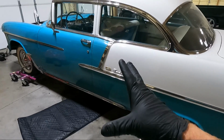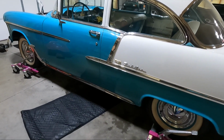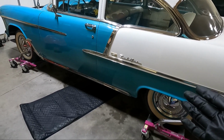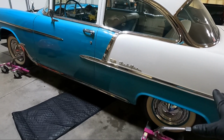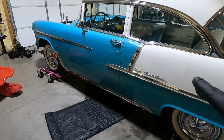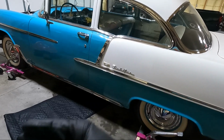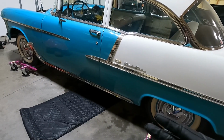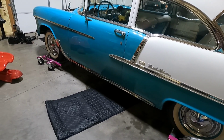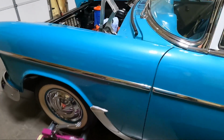And I'm laying in bed last night thinking, look, you have a lift. What are you doing? But ultimately, guys, I only have a few things to take off down here. So I don't even know that I necessarily have to take the exhaust. We're going to look when we're down there. We're going to at least get the drive shaft out. We're going to get the speedometer cable out, make sure there's nothing else other than the trans bolts. And if we need to get the exhaust out, we will, but I think the way it's routed way out on the sides, I'm not necessarily sure we need to take it out right now. So we're going to leave it unless I see an area where I think it's going to get in the way of us pulling the motor out. But I really think those few things is all we have left.